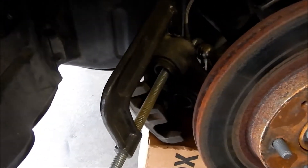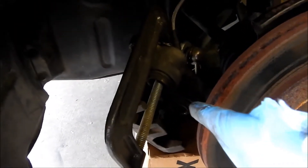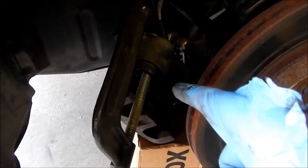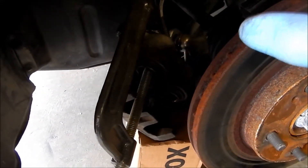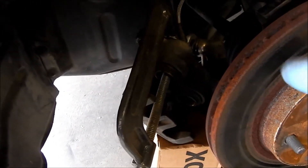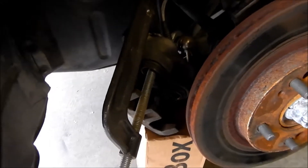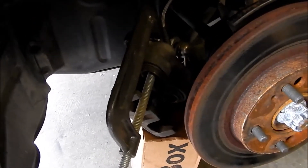Okay, so I got it in there. I had to use the big one because the caliper is quite large. It's kind of in there crooked a little bit, but the piston isn't going in — it shouldn't have that hard of a problem going in. I tried to squeeze it and it doesn't seem like it's moving so easily. But we got to push them in anyway so we can get the new brake pads in there.